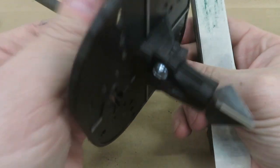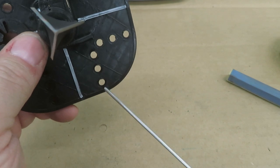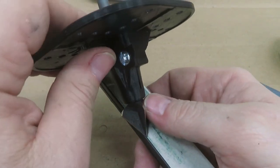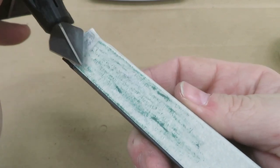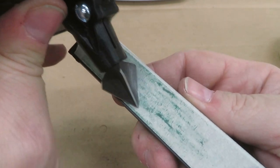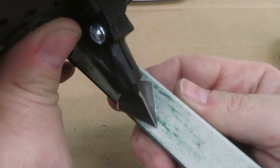Alright, we're going to find the blade we're working with. That's the one that aligns with the key. Again, we'll go into this hole. And for buffing, you always want to use a pulling stroke only. You're not going to ever push because you'll just snow plow that buffing compound right off the tape, or you'll cut the tape.